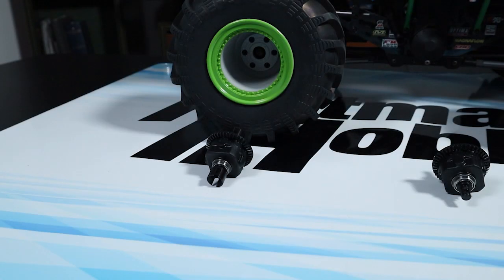A lighter fluid in the rear differential will increase cornering traction and steering into a corner, while a thicker fluid will decrease rear traction in corners and reduce wheel spin.